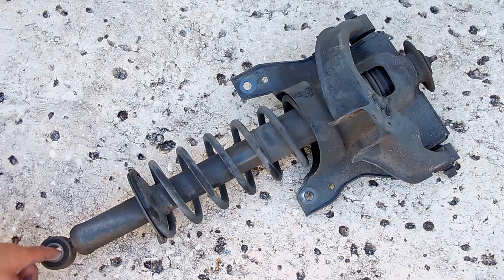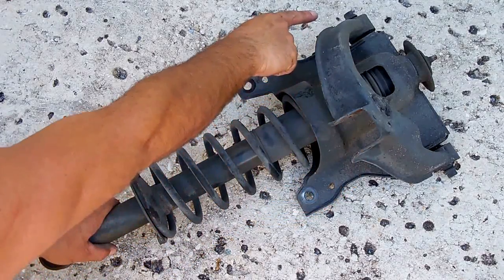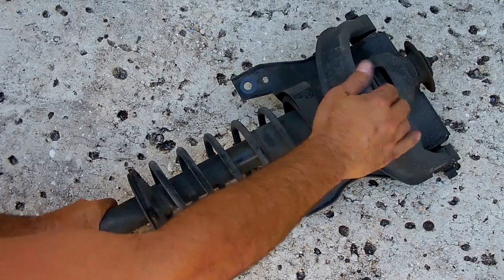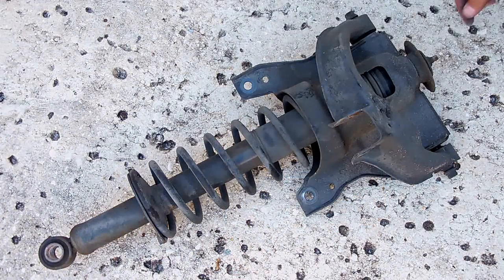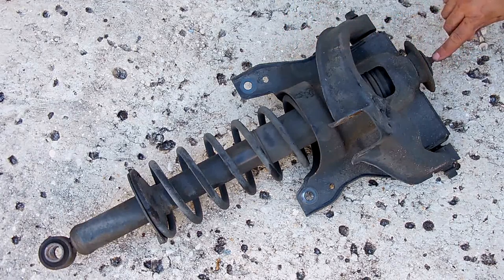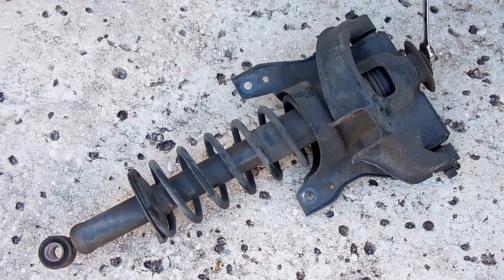Inside here is a little bit of corrosion — I'll show you what to do before putting this back together with the new one. Always make sure the bushing there and there is not worn. Move this around left and right; if there's excessive play, make sure you change either or both bushings before reinstalling. You do not want to remove the nut while there's tension on that spring — do not touch that. You're going to need a flat-end six-millimeter tool or a pair of vice grips, and that nut uses a seventeen millimeter.